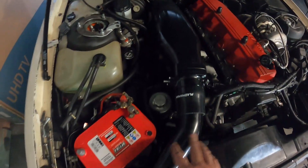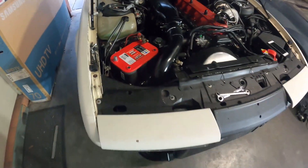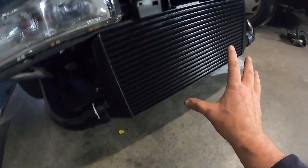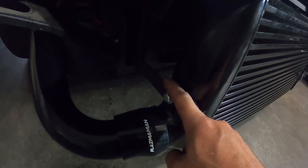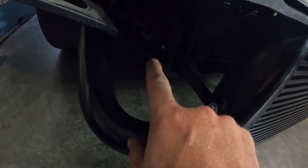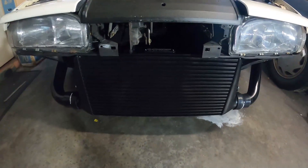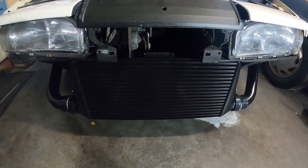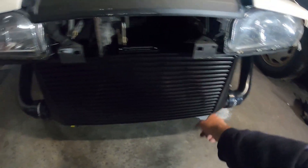The plenum is temp fitted so I could run all the cooler pipes. I did have to open up the hole a little bigger down here and also on the hot side. I ran the pipes down to each side in a ballpark area to figure out exactly where to mount the intercooler. The intercooler kit came with some brackets that lined up with some holes down the bottom, then I just bolted it to the inside of the tabs where the grill goes up there — worked out well and it's solid as a rock. I trial fitted the front bar and it fits — I just need to shave a little bit of the lower lip because it's hitting slightly on each side.